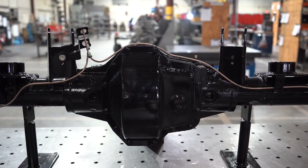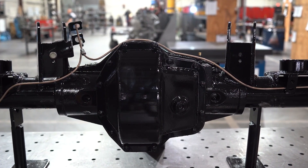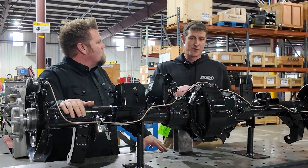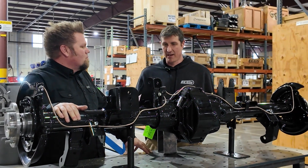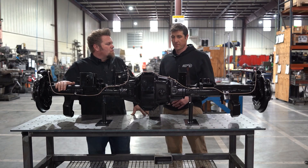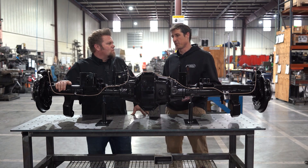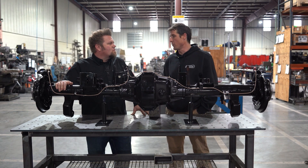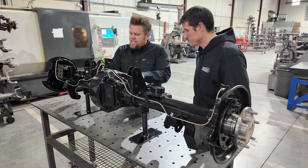When you put 35-inch tires on and you're trying to overland, put a lot of miles on a vehicle, go camping and off-road, the 8-inch differential won't get it done anymore. So they came up with the Dana 60 for the 4Runner and FJ Cruiser. They could also do a 9-inch, but they prefer the Dana 60 for street noise, bigger bearings, bigger ring gear — this is their high clearance casting.